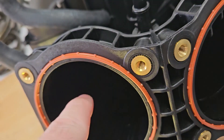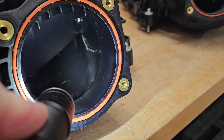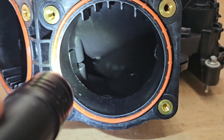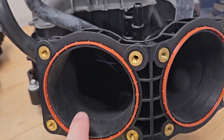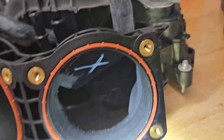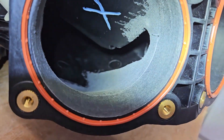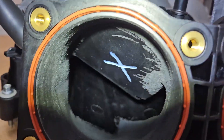There's a huge lip — almost a quarter inch — a step down. I blended all that and got rid of it. On this side there's a big bump, and I mean it's actually pretty significant — the flaws in this factory casting. I don't know how much performance it's robbing, but I'm just showing you the factory inside. Now see the difference: I opened it up on the diameter about a millimeter on both sides, smoothed it all the way to the roof, and went down deep. The amount of material I took out was pretty incredible.